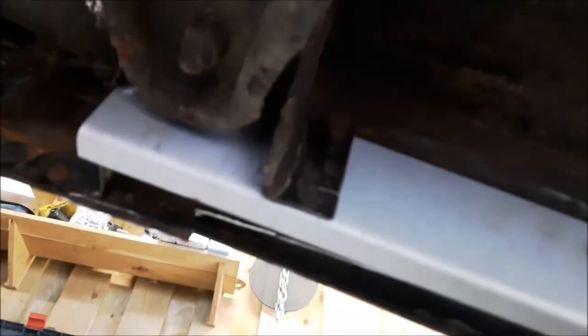Then I've got this piece, which has got a way around. This goes up and that then just seam it along the top, the trailing edge. That should cover in the main part of the sill, and I can weld the body mount back onto it, as you can see there. Then I've got this piece, which goes up as the outer sill. So that then boxes in the sill, goes in like that, and should do all that job. But obviously I've got the problem with the A-post closing panel, which I'm just going to weld in first of all.